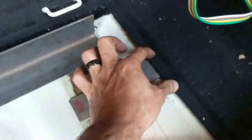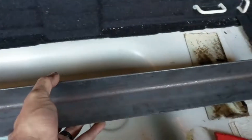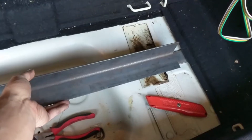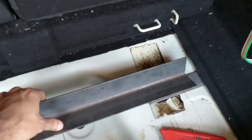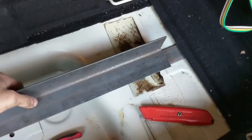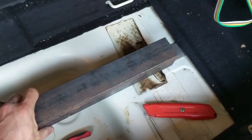So what we're actually going to do, we're going to cut through here to get some space - it's about three feet across, actually 37 inches - so we'll get a little creative with an extra inch or two and basically we're going to create a box section right here in the trunk. Hopefully it won't take away too much space, just lifting up the floor to be somewhat even with the back seats. We'll put one angle this way, fully weld it all the way across, then put a second piece that way as well. That's how we're going to reinforce the rear subframe and tie it into the actual frame rails.